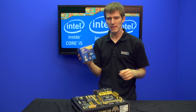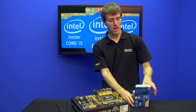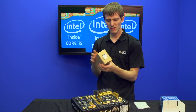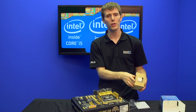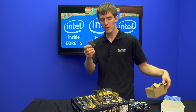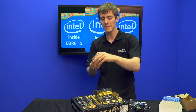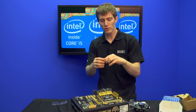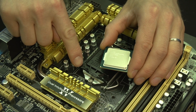The performance is different and the box art is definitely different, but there's going to be some things that are familiar about the new Core series processor. In fact, it even pretty much looks exactly the same once you get it out of the box. We're going to show you how to install your new Haswell chip. Even once you get it out of the plastic sleeve, making sure to ground yourself and be working at an anti-static workstation — I use an ankle strap — you're going to go 'okay.' You align the golden arrow with the little arrow indicated on your motherboard socket.